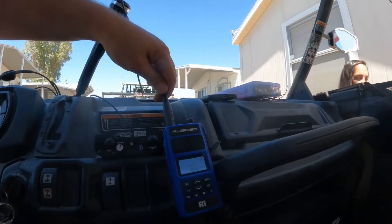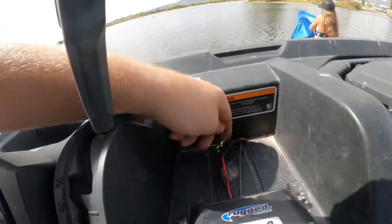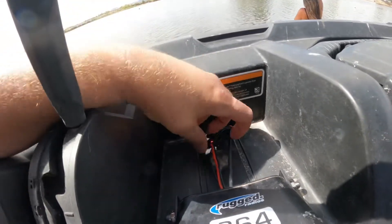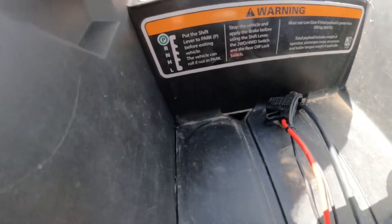He is getting communication from me, so that's pretty fantastic. Like I showed you earlier, I'm going to mount the radio in this vicinity so it's all tied in together. I've actually shaved my beard because the last couple days have been pretty hot, and we're down on the beach — the Colorado River — to finish this install. The 364 intercom from Rugged. I drilled this hole a little bit bigger so I could have access to the fuse for easy wiring. I'll probably put some wire loom here so it doesn't look too janky.